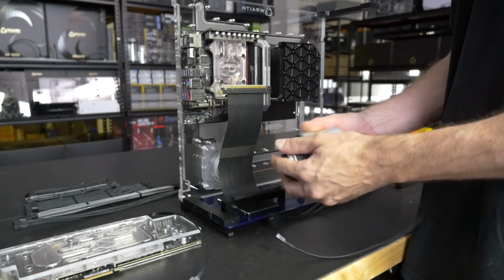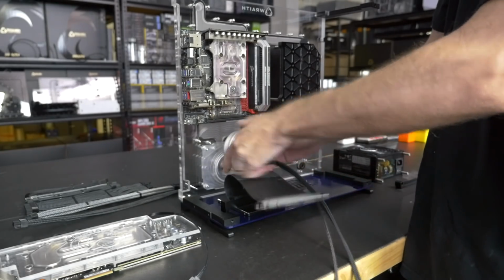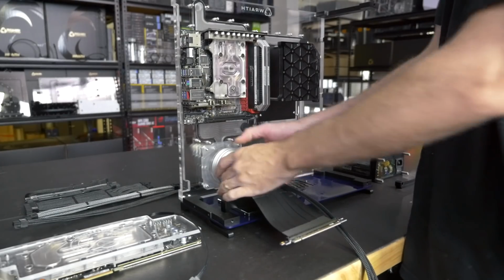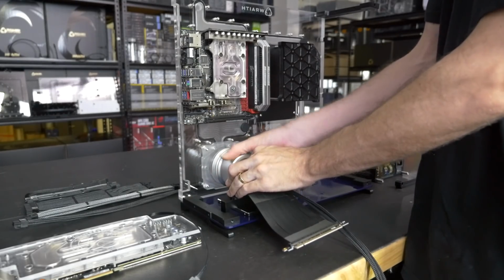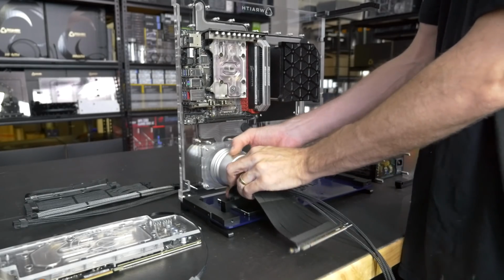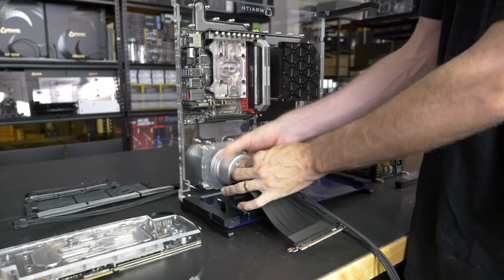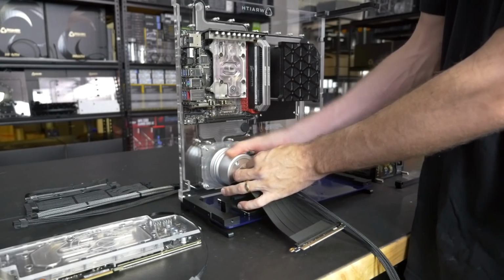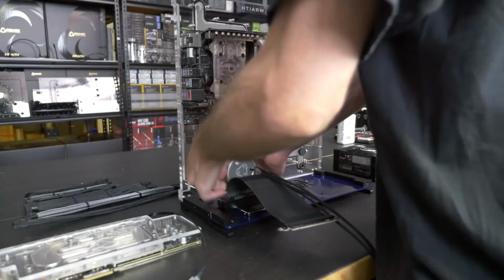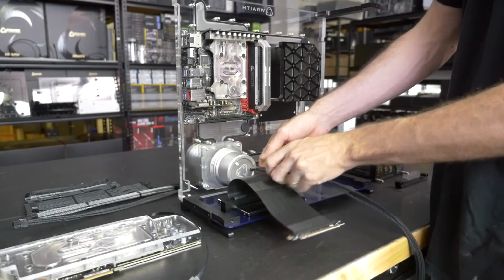And you can see the Protium pump cover, we've actually swapped it out for a silver one in this build. Normally it comes with a black with silver rings pump cover. But this is actually a 3-piece pump cover. The retention ring comes off the sleeve part. And that's what you do when you're installing like the Aqua Computer D5 Next. And you also don't use the back cover if you're using that pump. So it makes it compatible with pretty much any D5 pump that's out there.